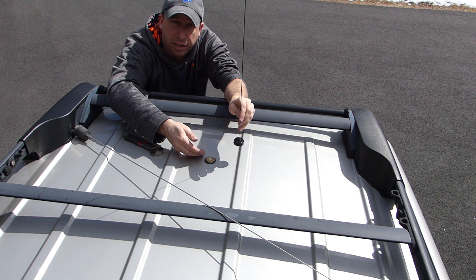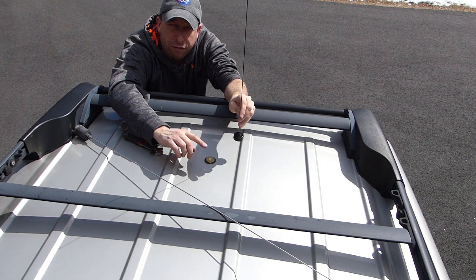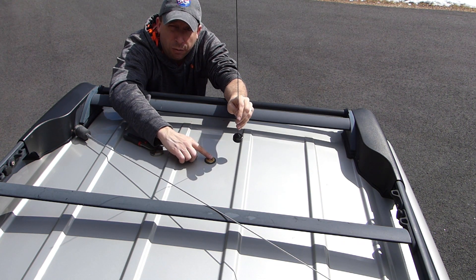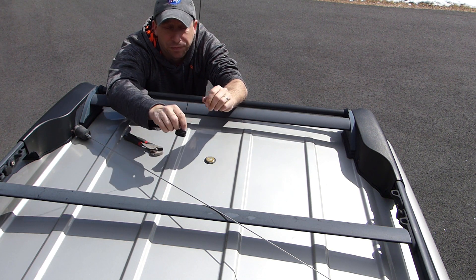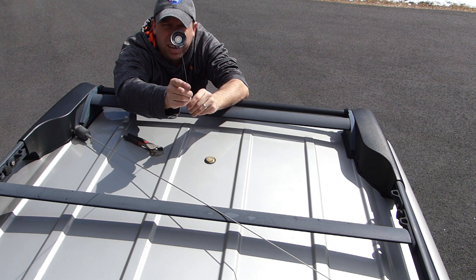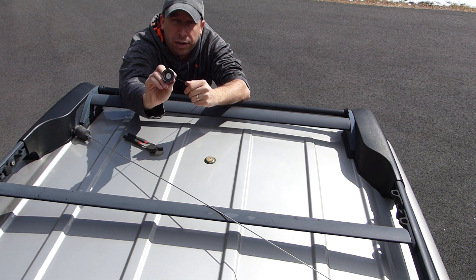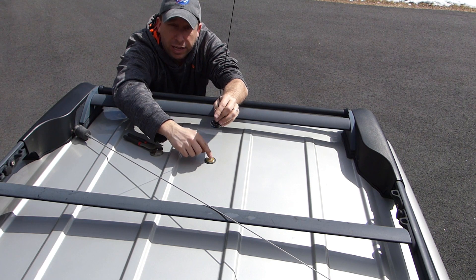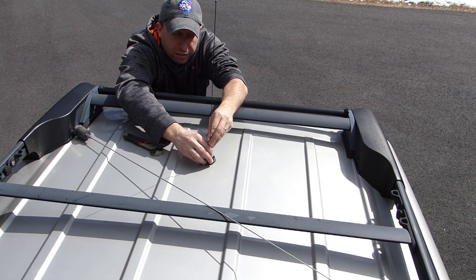To fix that, I've gone inside the vehicle and added some washers underneath the bottom of the mount. That's maybe not ideal, but it should work fine — the net effect is it lowers the post so it's just slightly proud of the top of the mount, more like a true NMO mount. I've also added just a small amount of never-seize to the threads on the antenna base. I've had problems with antennas welding themselves to the NMO mount before, making it impossible to remove the center piece without ruining it. So, let's get the antenna on the Tahoe.